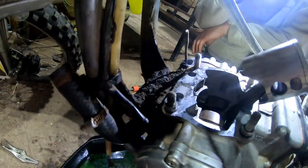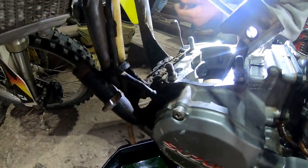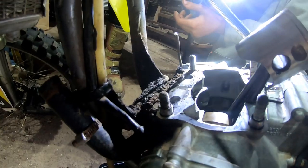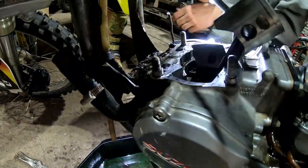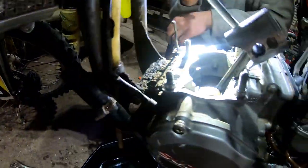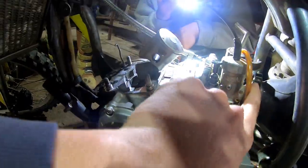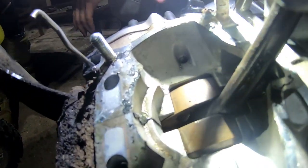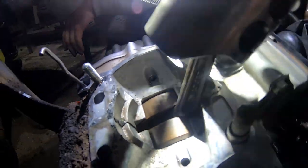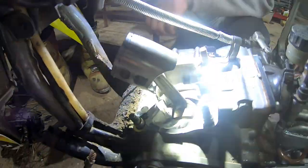We'll pull the motor now, which is going to involve the swing arm and some bolts up front. The water pump will get rebuilt, the seals. We'll check the clutch and see if it's goofy — they might have said they did a clutch at one time, might have said they sanded a little off the discs. First thing is going to be draining the oil — weight reduction. Now we will have to remove the carb, carb air box. That's the typical lower rod bearing failure. Most likely in this case maybe a lack of oil, because they may have ran straight gas in it.